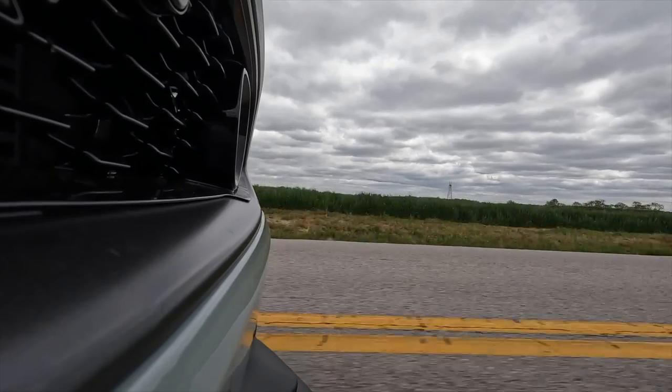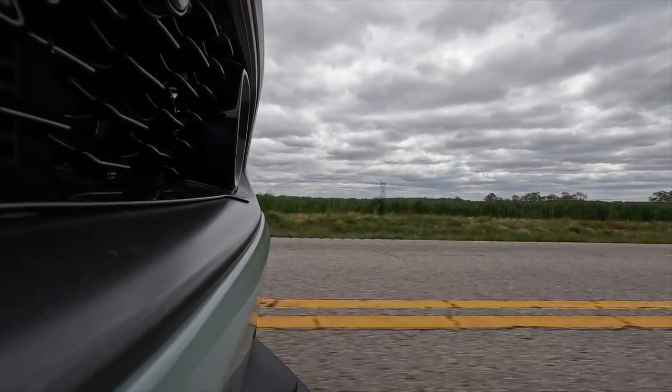Let's do a pull real quick. Starting at 3,800 RPM, IATs at 64 degrees — 60, 59, 63 — and let's hit it. Very fast. Let's get back down to the speed limit. I saw 76 degrees on the IATs, and now it's immediately coming down. We're at 59 over here, 68 over here and dropping — so very fast recovery.